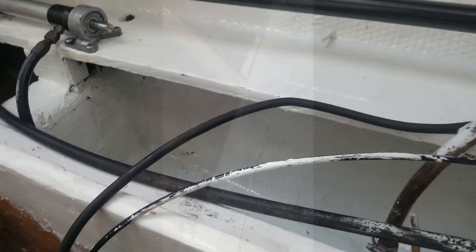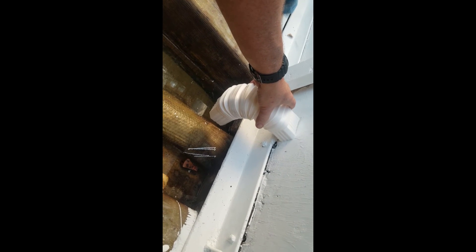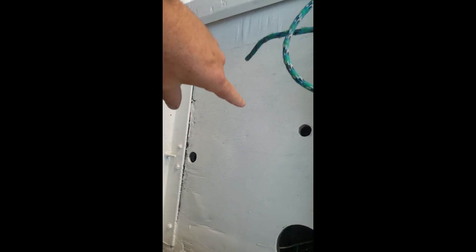I'm going to redo how I do this — here's another idea. Let me know what you think, even if you think it's crazy. Once the floor is in and the tanks are back in — the tanks go across here — there weren't any vents in this area at all. So I'm thinking: cut this, bring it through here through a hole fitted into the plywood, seal it around it, and it'll draw air out from underneath. Then there'll be another blower, a couple of vents up here somewhere, probably down low. The blower motors will be on the other side of this wall so I can get to them without having to take the floor out.